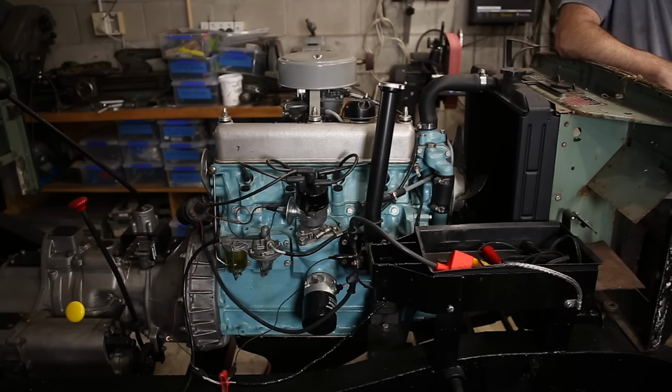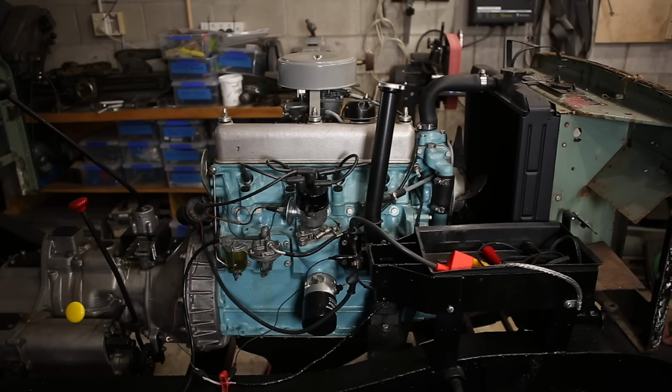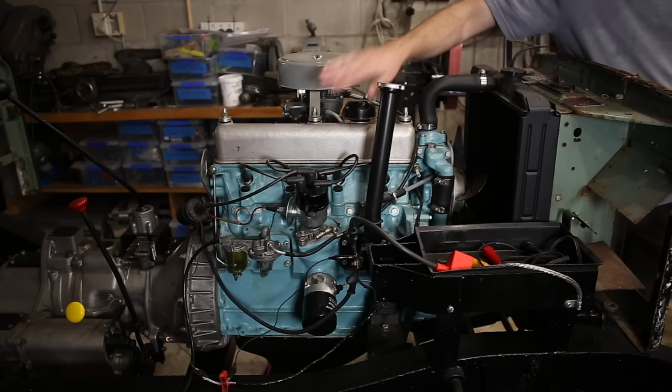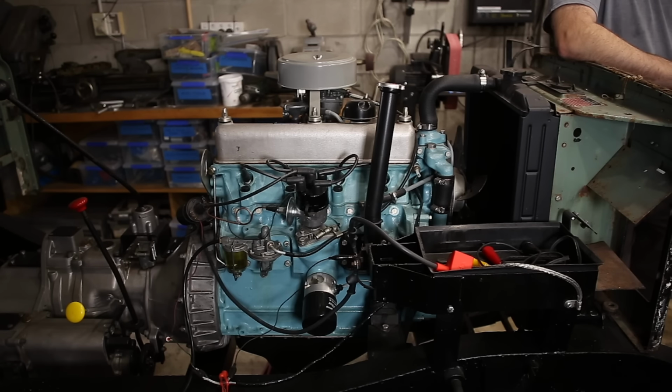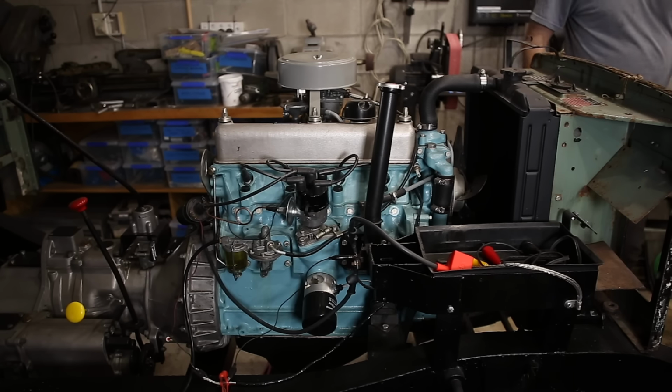I know that because I'm the guy who disassembled and painted it. Now, you're probably not going to get a good sample from an old engine, and I couldn't either. But the PTO covers were a painted engine colour, and the paint on my PTO cover was in excellent condition and matched the engine. And that was polished and scanned. So this is not from a paint code. This is a scan of a match of a really good sample of original paint. So we can end this debate now and move on. This is the correct Land Rover engine colour.